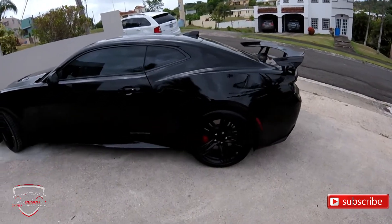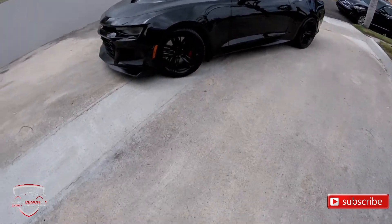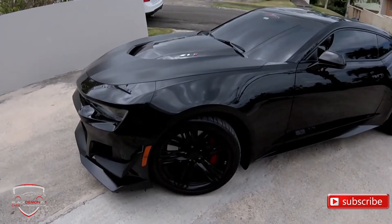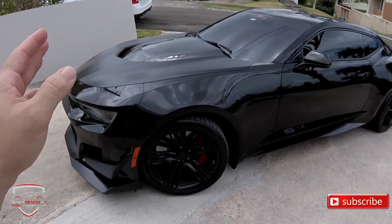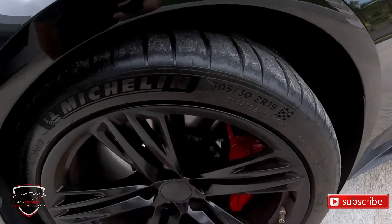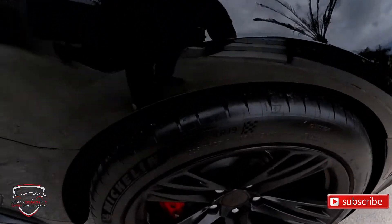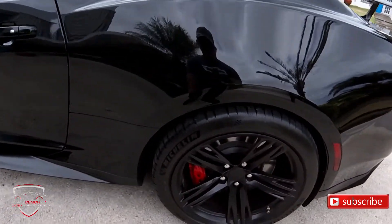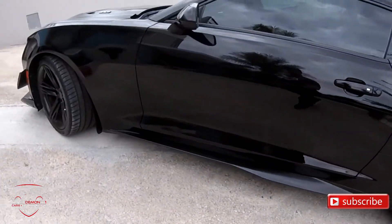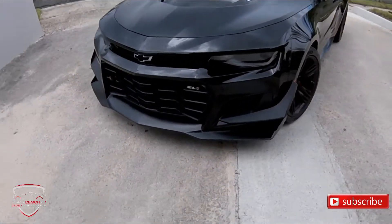So the first things we appreciate on the exterior of the car are the full aerodynamics system, all the body kits, and obviously the brakes, which are extremely large. We also notice the wheels, which are specific to the 1LE — 19-inch. The front tire is a 305/30/19, an extremely wide tire, and in the rear we have 325 from the factory. Those are the factory sizes, and you can see the '1LE' marking on the calipers. This is one of the things that differentiates it from a regular ZL1.